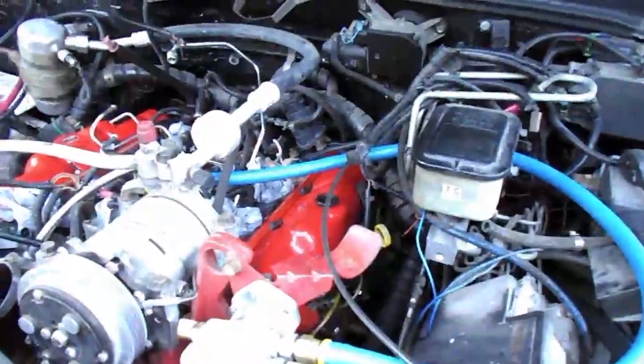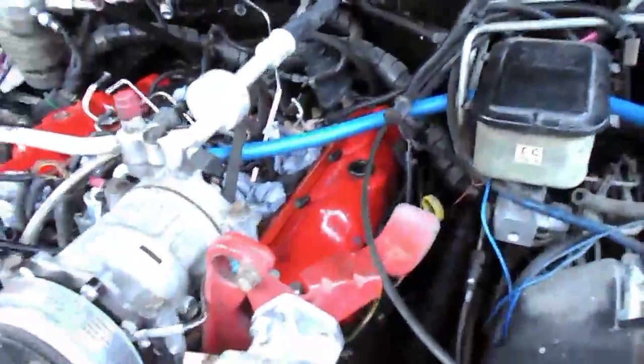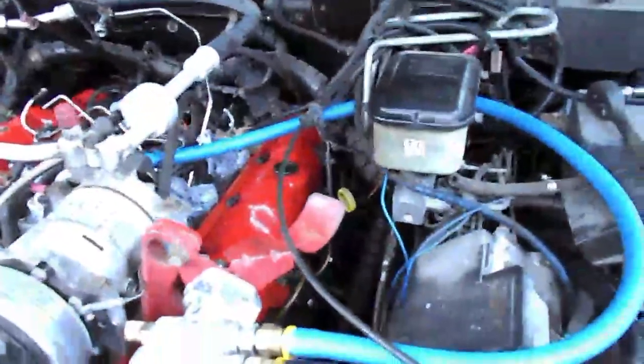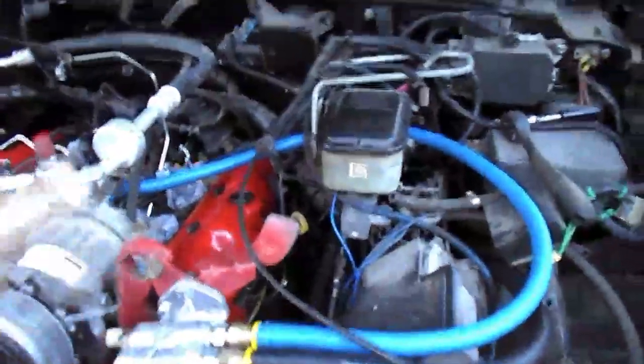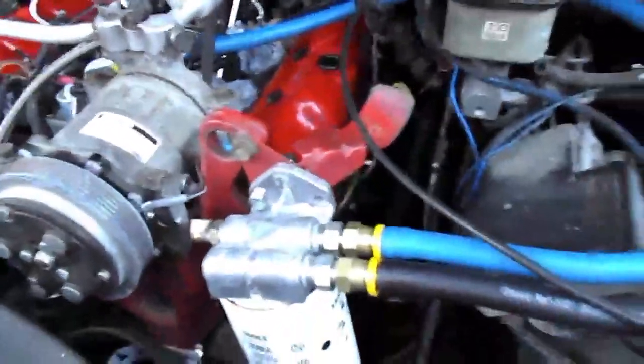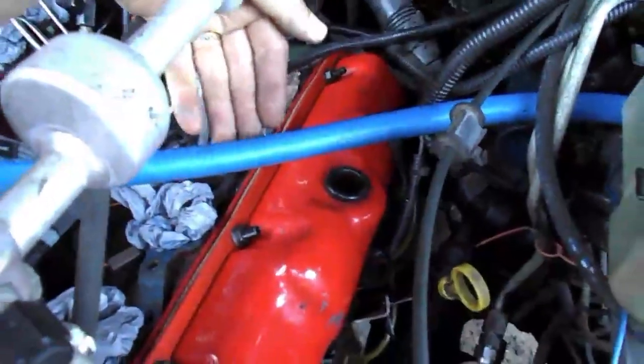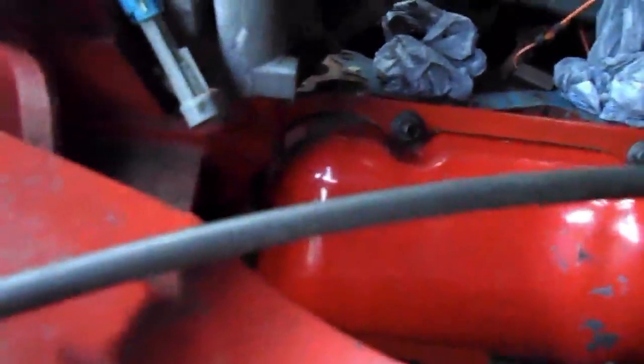This is the third part of the video. You can see the girdle has been installed. It's actually a little bit tougher to do on the driver side than on the turbo side, assuming you have the turbo and everything removed. A little tip — this is a '96 and newer; the '94, '95, '92 and older may be different. By the way, this will also fit 6.2s. You're going to bring that girdle in kind of under and angle it so it fits in that little gap — it has to be angled a little bit downwards.